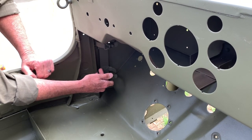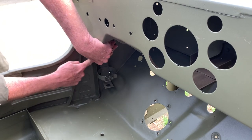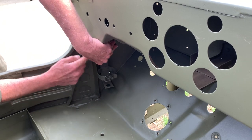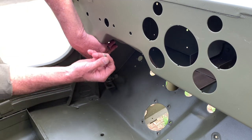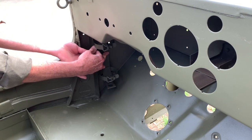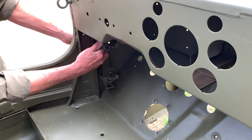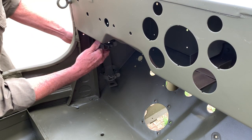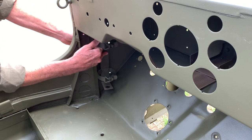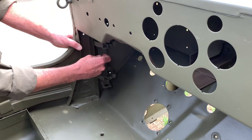Check that your holes line up and then go ahead and install your fasteners. Install one bolt in the middle first — the head goes on the outside of the cowl and the machined end comes to the inside of the bracket. Installing one in the middle acts as a lever, holding the bracket inside the Jeep so you can wiggle it back and forth to get all your holes lined up.